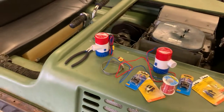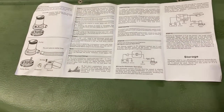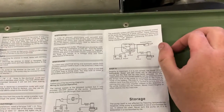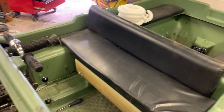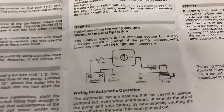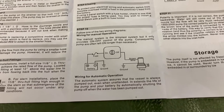It comes with pretty good instructions. This is the circuit I'm going with because I literally just want to flip a switch and turn them on for emergency only. Another way you can toggle them is with an automatic switch — you can even have them on a float switch, so if the level inside the machine gets to a certain point it'll flick on. But I'm going the easy way. We have a positive which goes to a fuse, then to the switch, and then the positive runs down to the pump.